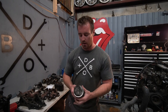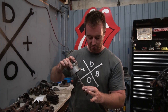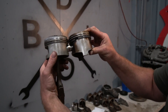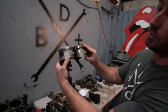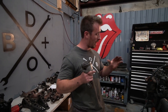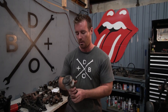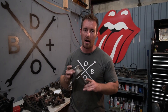If you get the late piston — the lightweight updated piston — it has more clearance than even the factory clearances for the B27 crank. Here I'm going to show you wrist pin to wrist pin: at the lowest part of the clearance area, the B27 still doesn't have as much clearance as the 325i lightweight piston. So if you're doing an M20 B27 stroker build, this is the piston you need to use.